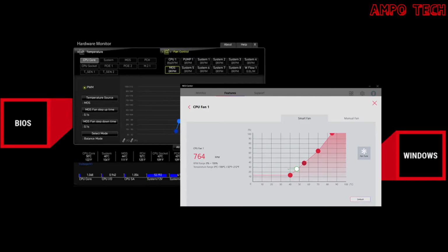The total fan control, which is fully controllable in BIOS and software, means the MSI motherboards let you manage speeds and temperatures for all your system and CPU fans. Total fan control allows you to check your primary system characteristics in a simplified graphical interface. You can also set up to 4 temperature targets for CPU and motherboard, which will adjust the fan speeds automatically.